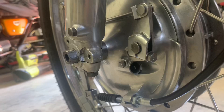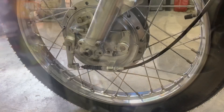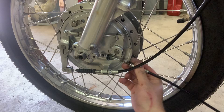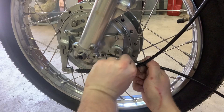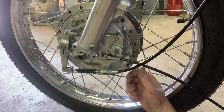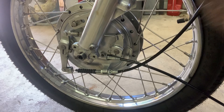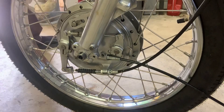If you can't see it, you just got to push the end so you can expose it on this end. What we're going to do is just insert the slot, get the slot in place, and then push this on until it's flush just like that. I'm going to grab this bolt and position it. My hands are so sweaty today — it is so hot. I'm going to grab my JIS screwdriver. These JIS screwdrivers are going to save you a ton.